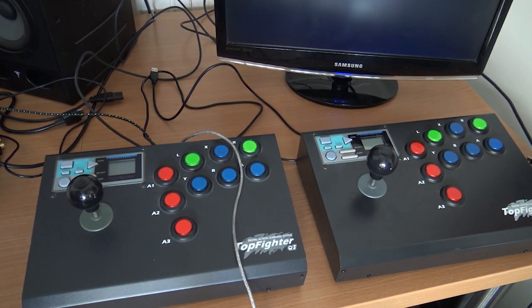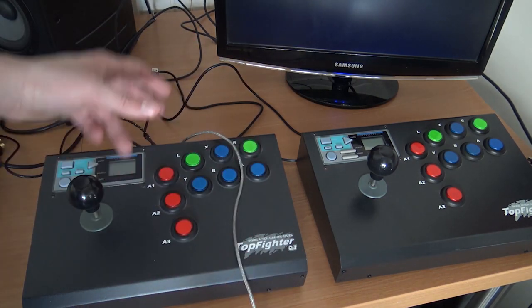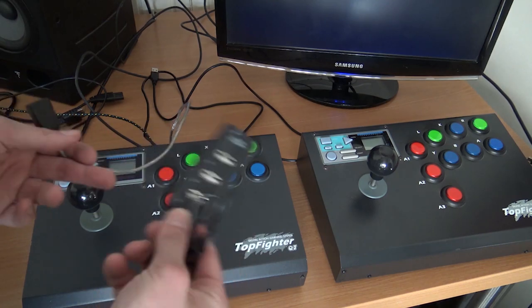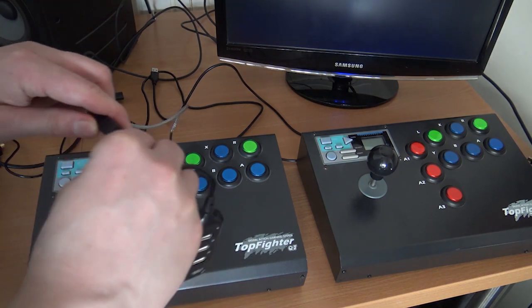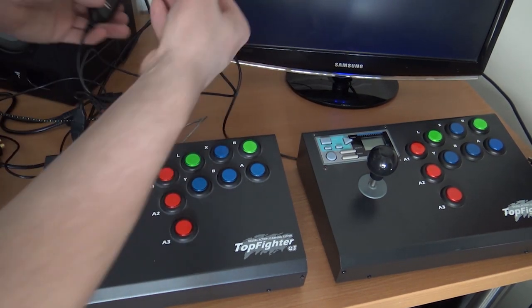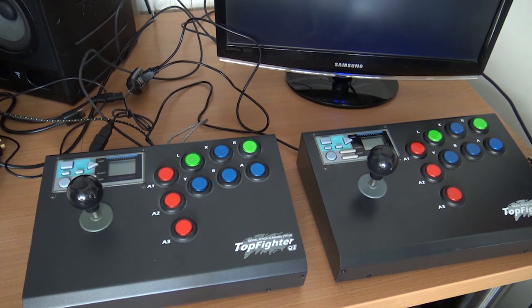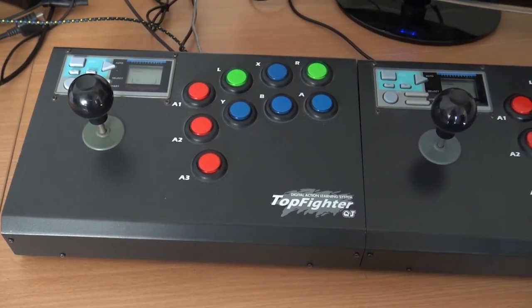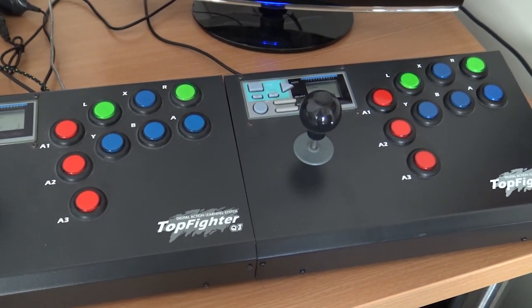In this part I want to show you how to connect a second controller. Basically, the Raspberry Pi is inside the main arcade stick, and we have a female USB port that I've already shown you. What you do is grab a USB joystick and plug it in here. Then grab the USB connections for player one and two and put them in. That's the only thing you need to do — boot it up and everything is configured automatically. Both controllers are recognized and you can play games together. So we're having two joysticks from the 90s connected together, and you can do this with up to four joysticks in total. I think that's pretty awesome.